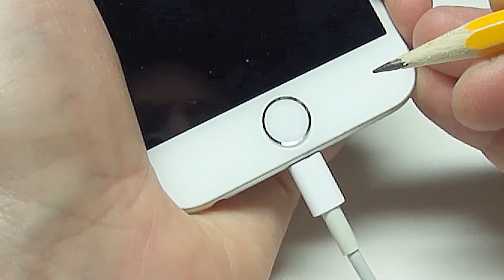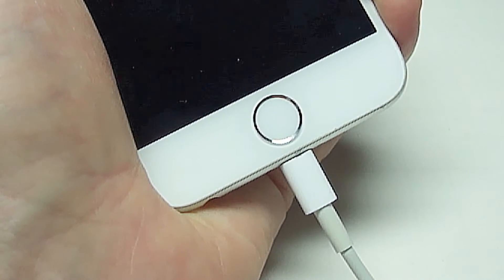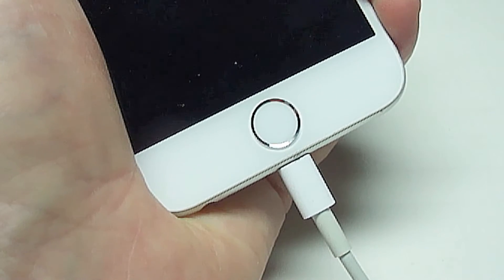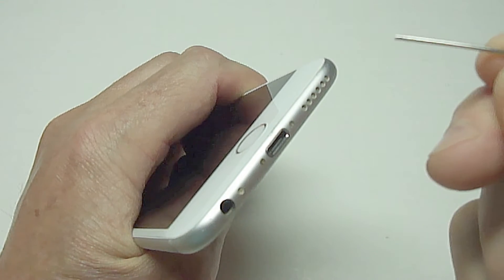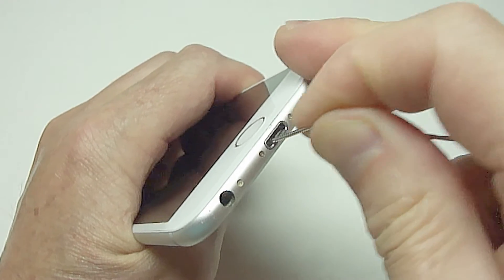The good news is, if there is any kind of gap here, this is due to some kind of foreign matter inside the charging connection on the phone which can easily be removed. Lint from clothing is very common, but you might have something else. The easiest way to remove any foreign matter is just get a paper clip and scrape out whatever foreign matter is inside the opening.